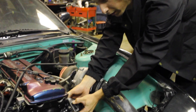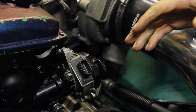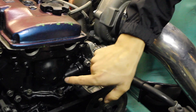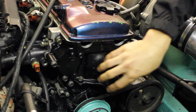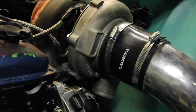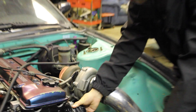Also, if you're having a lot of trouble pulling it in and out — like it's a ton of work to press the distributor in and you can't even press it in with one hand — the problem you're probably having: people on forums say it's the o-ring, which could be the problem, but the problem I've noticed is that your timing cover right here hasn't been machined. I've already gone through like three distributors and two heads because this front timing cover wasn't getting machined, and it was making it really hard to press the distributor in. So when you get your head resurfaced, or if you're rebuilding your whole KA, make sure you get this front timing cover resurfaced or your distributor is going to be hell to put back in. Resurface that and your distributor should pop in every time.